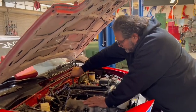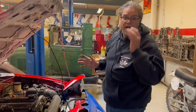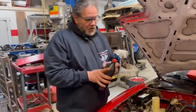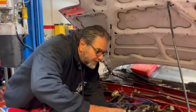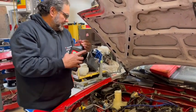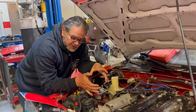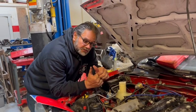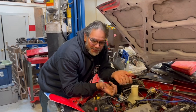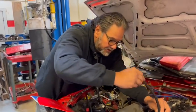I've had street cars that were under 115 and I can tell because when I drive them uphill they don't have a lot of power. Now I can separate whether the issue is rings or valves. I do that with a little bit of ATF fluid or engine oil - this is called a wet test. The oil lands on top of the piston, spreads out, goes down past the rings and temporarily seals them. If compression comes up significantly from 30 to near 150, I know it's a ring problem. If it doesn't come up much, it's the head or valves.